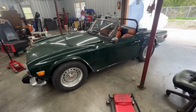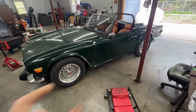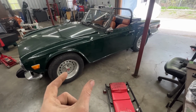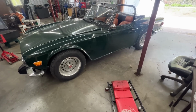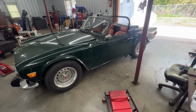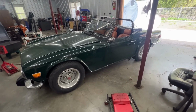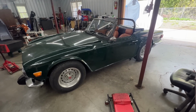Right, unfortunately, spacing out the clutch didn't help. Like I said, probably we just shifted the part of the stroke of the slave cylinder that we use. We didn't make it longer, you know what I mean? So what I'm gonna do is try one last thing that I can think of. I'm gonna try to bleed it, maybe, if it has a little bit of air inside, but the pedal feels really solid, so I don't think that's the problem, but let's try to bleed it.